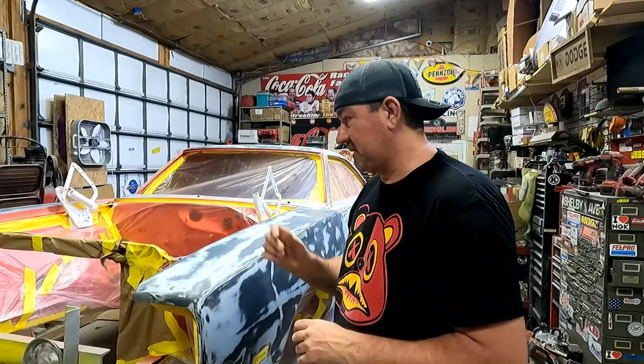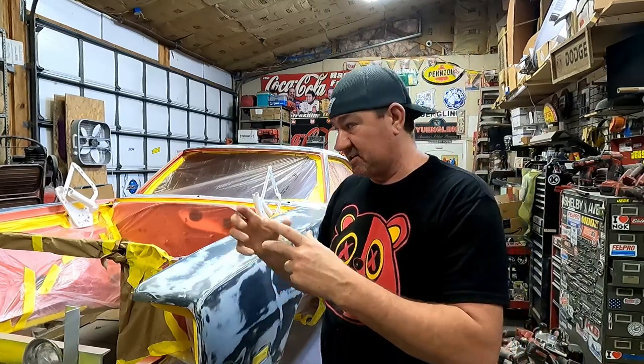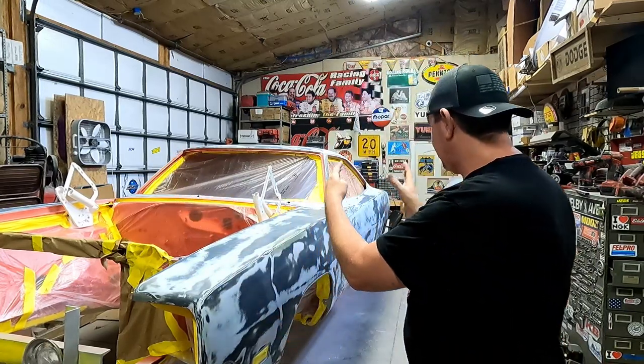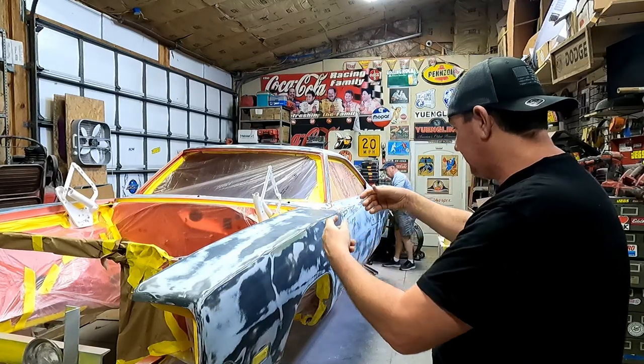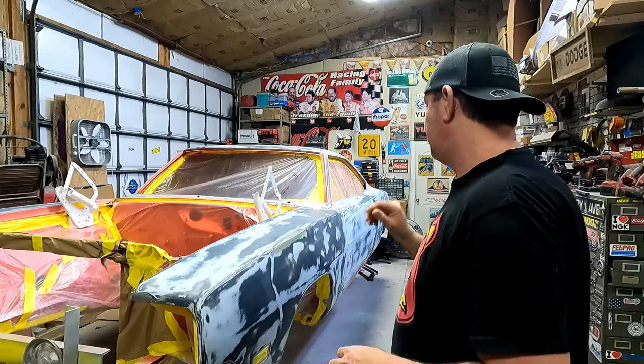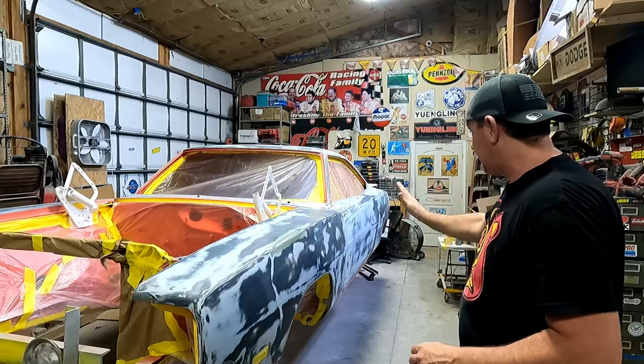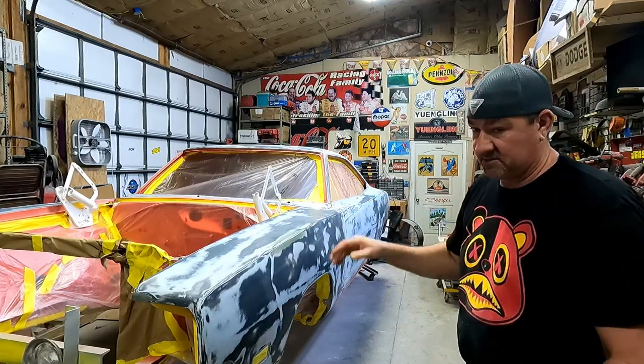So thank you for watching. Hopefully you found something interesting. Maybe the foam. Maybe how we got the doors with the towels and stuff in there. For some of the other cars that we've painted, we put a wooden block of some sort that we fit to the right size to make the doors close on each other and be super tight so they're not gonna fall on the ground when you're rotating them on the rotisserie, but still be the right gap to where that is how the body's gonna look when it's all done and said.